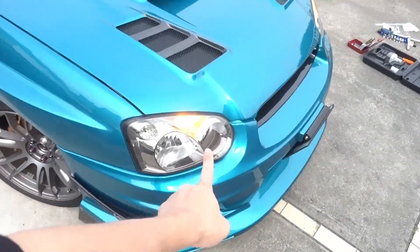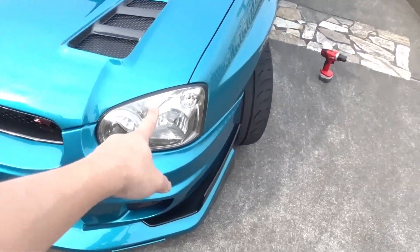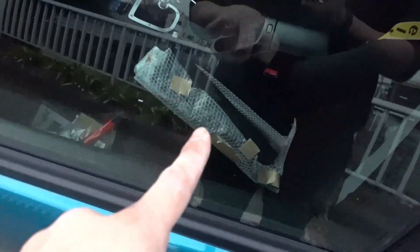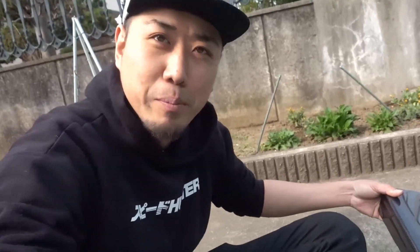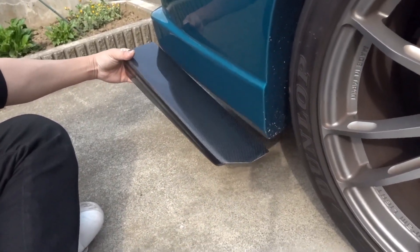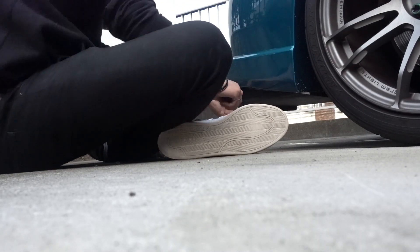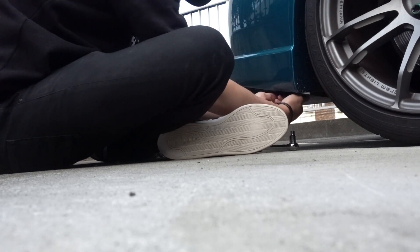All I've got to do now is work on the headlights — make it black interior and put some halos on. It's going to be sick. But I'm still going to need the drill for the canard, so I'm glad I bought it. Okay, the next step is the canard. Let me show you where I'm going to put it — right there. That's the rear view. In order to install the canard I have to take off the diffuser, so I'm going to unscrew the bolt underneath. So now that the diffuser is off...